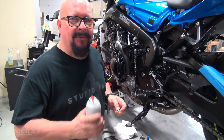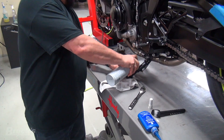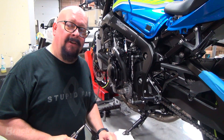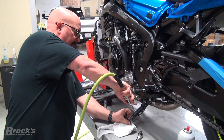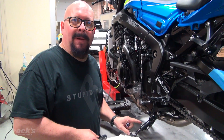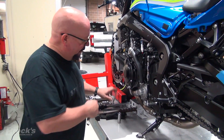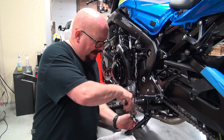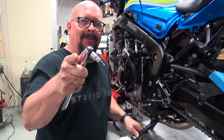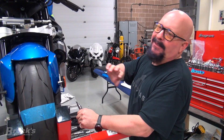We're going to go ahead and Loctite this. Loctite is bolt glue - bolt glue does not stick to grease. So we're going to go ahead and clean the surface of the threads. Blow it off. Please use a respirator if you're afraid of the fumes from the brake cleaner. Plenty on here. The torque spec on this six millimeter bolt is 80 inch pounds - that's six and a half foot pounds. That's too low for my foot pound wrench to go, so I've got Loctite and I'm going to use my head. Use a torque wrench if you have one - otherwise just tighten it up so it's not going to fall out.